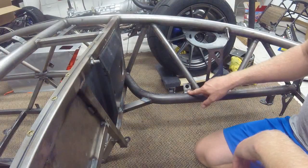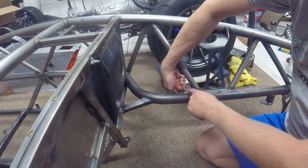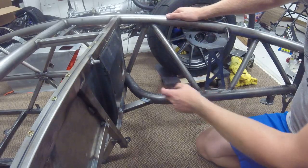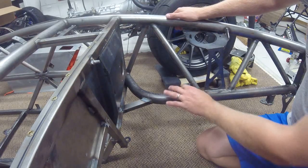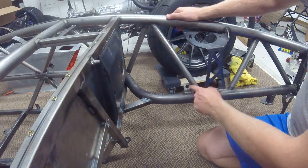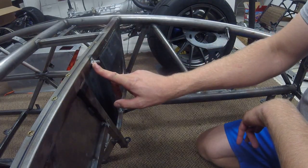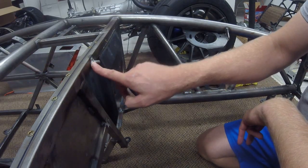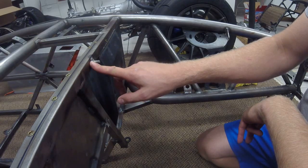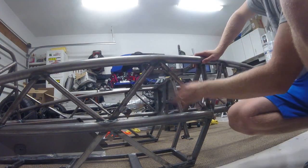Here is a brake line bracket for the front brakes. Right at this point my braided line comes in and my hard line intersects right at this bracket, with a stock brake clip securing it to the mount. It's basically another piece of eighth-inch flat bar with a hole drilled for the width of the stainless line, welded in at two points. Also right here is a ground stud — this is the chassis ground for the head, grounded at the cam angle sensor, with a four-gauge line going to the chassis.